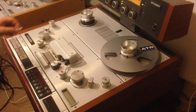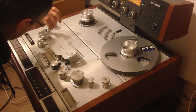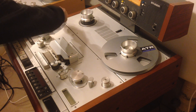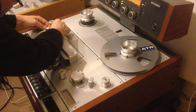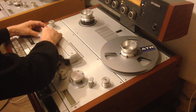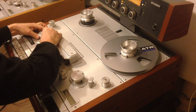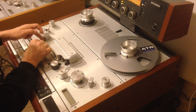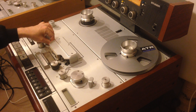With the cleaning solvent and cotton buds, in a logical fashion, clean the rollers, guides and the heads of oxide and binder deposits. With the increased likelihood of older tapes being played on machines, some of which will be suffering from sticky shed syndrome, the chances of large deposits of oxide and binder being stuck on other parts of the tape path are high. The cleaner I use is isopropyl alcohol in a spray can — it is reasonably cheap and is ideal for the job. Ones from the local pharmacy are ideal for cotton buds.